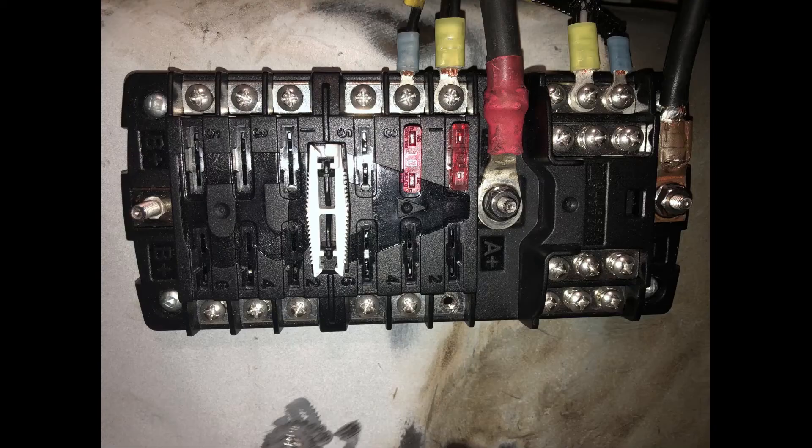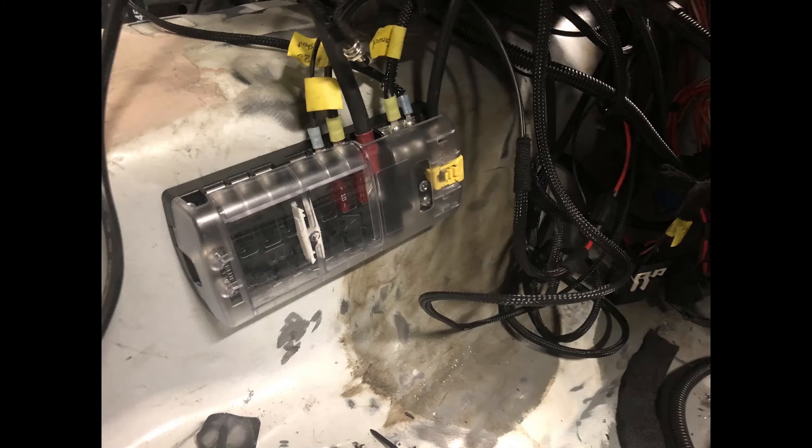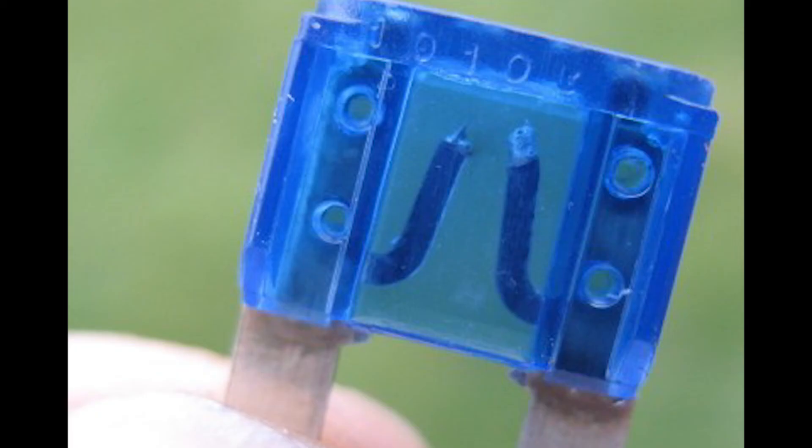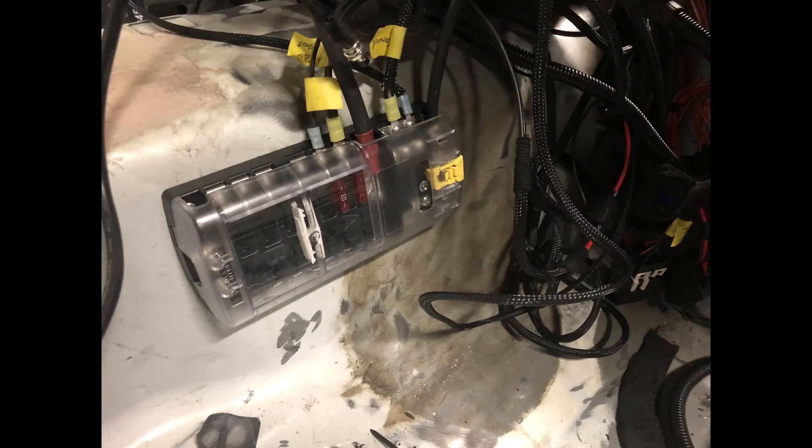This is the additional fuse box that I have added to the vehicle. This will have the wiring for the ECU as well as any additional accessories such as the radiator fan. I have mounted it on the side of the passenger seat. These are fuses — they are rated in different amps, not volts. The higher the rating, the more power it will take to trip the fuse. When a fuse is blown it will look like the bridge connecting the left and right terminals has broken. When it exceeds the rated amperage, that part breaks and stops the circuit, which is a good thing because it is far cheaper to replace a fuse than to overload the part it is protecting.